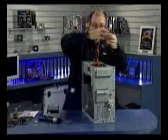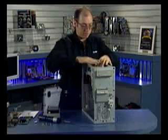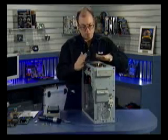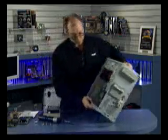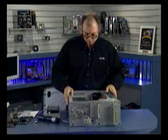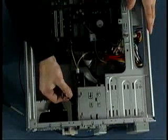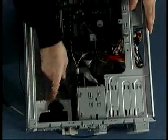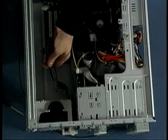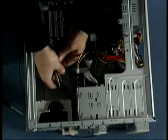Now all the drives are cabled. I can take the remaining power wires and tie them up at the top of the case. You could use zip ties to secure them neatly. Now the final connections to the motherboard are the small front panel connectors — for the front power switch, the LED, and the chassis speaker. You'll need to use your motherboard manual to determine how those connectors are oriented. They're usually small connectors near an edge of the board. I'm going to plug these in now.